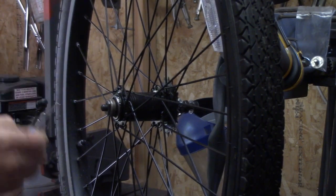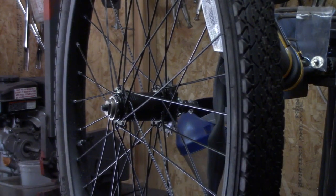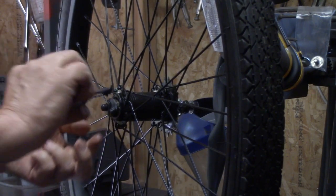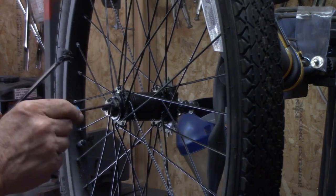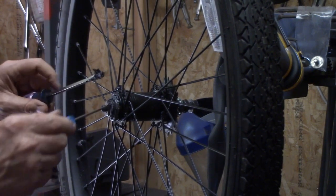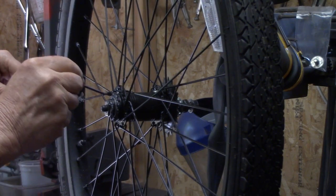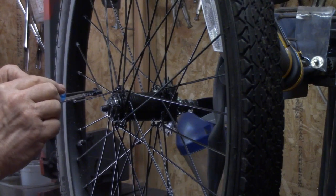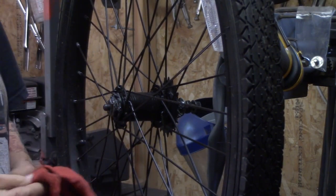If you do botch this process, I'll put a link down below showing you how to service the hub. I've got a video series on what to do if your rear wheel is locked up. You'll have to go in and do some surgery - basically get the little brake pads, the clutch cone, and the anchor cone all properly set. If you don't turn the anchor cone, you're not going to have that problem. Just pack a bunch of grease in there - you want grease on both sides of the bearing, where the bearing mates against the anchor cone, and where the bearing mates against the cup.